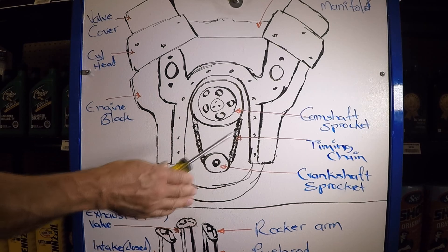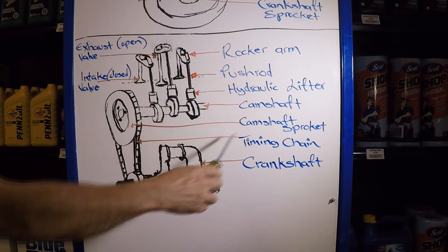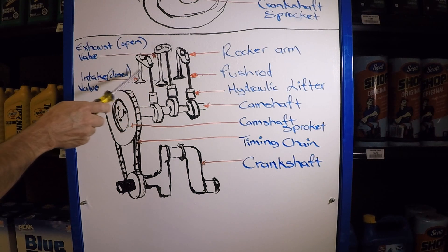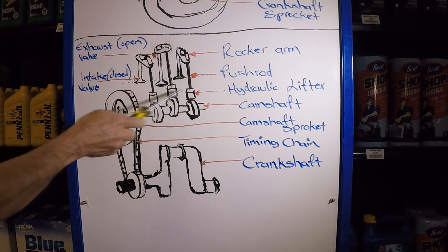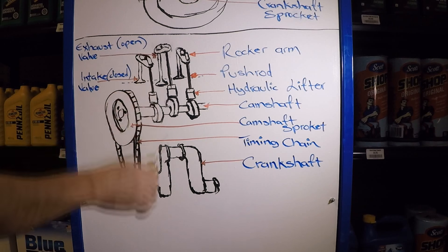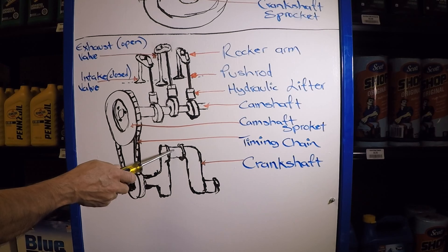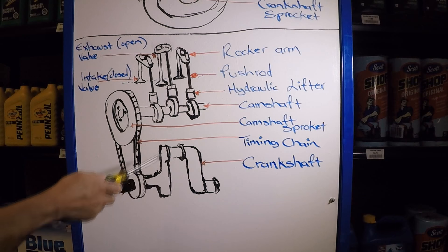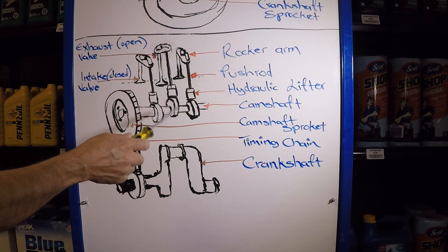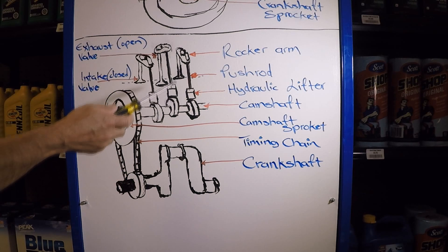Now I'm going to move the camera down so you can see the actual parts inside the engine. This section would be your engine block down here and your cylinder head up here. Starting from the top again: you have your rocker arms, your valves, your push rods, your lifters, your camshaft, camshaft sprocket, timing chain, and crankshaft. The only thing I didn't draw — just because it would look too cluttered — was the connecting rod and the piston. The connecting rod is attached to the journal of the crankshaft, and as the crankshaft rotates — if you watched the previous video — you can see how it moves the connecting rod, and the piston is attached to the connecting rod with the wrist pins, so it moves up and down to enable the air and fuel to enter the cylinder and compress it as it goes up.